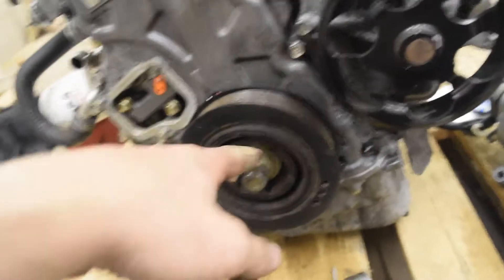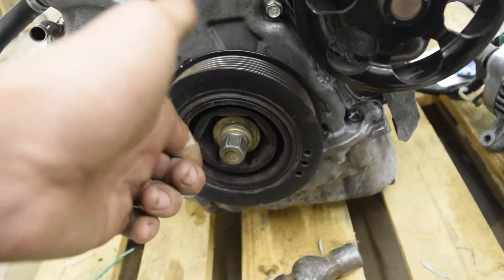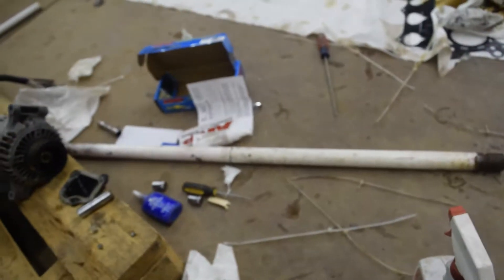What's magical about this pulley bolt is that it says torque to 36 foot-pounds and then rotate it 90 degrees. I definitely needed a cheater bar for that. It's been one hell of a long day — started about 12 hours ago. Been doing this job really slow, but taking my time, making sure I do everything right, and I think that's what's important. Gonna button this up tomorrow — do the valves, do the clutch flywheel, get the radiator mounted in, put the motor in, and call it a day. Hopefully I'll have enough time to just screw off and do nothing, because I'm tired, man. I need a break. Till next time, see you guys later.